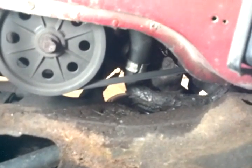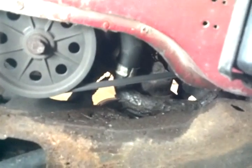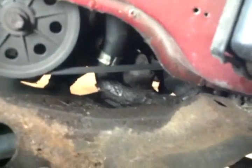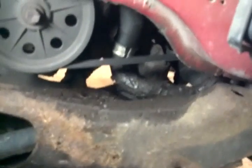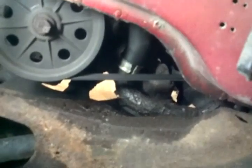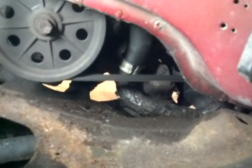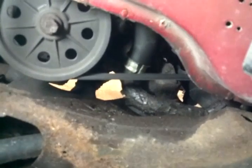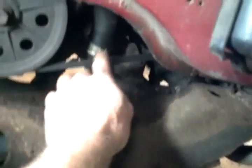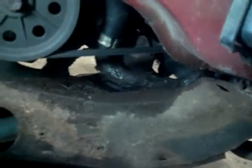I did some other looking around. They do make a universal radiator hose that's got the spring inside of it to do all them flexes and corners and all that. And I think it's 1.5 inches ID on both ends, 21 inches long, this universal hose. But I've also read it gets kind of iffy by that belt area there, especially when it heats up.